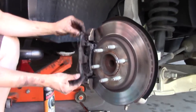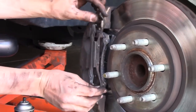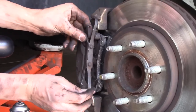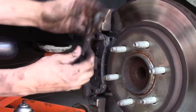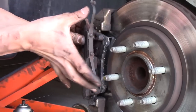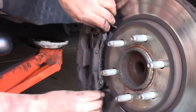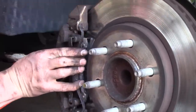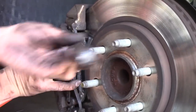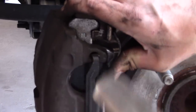What happened here is that because the new brake pads are so much thicker than the old ones, the edge was riding right there and was going to slip off every time. It was being such a pain that I bent the clips back so they're further this way, which makes the pad go further the other way. Let's see if this works — and there we go.